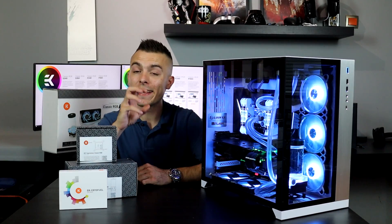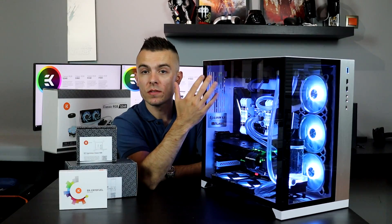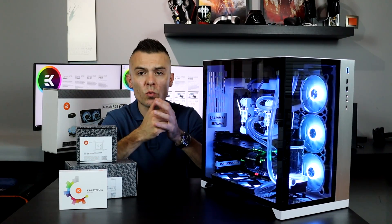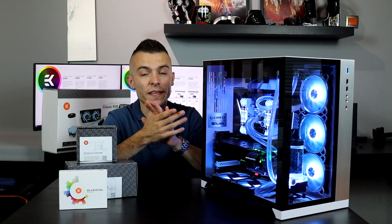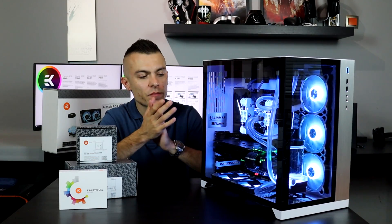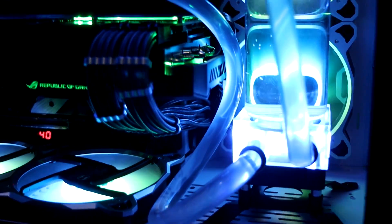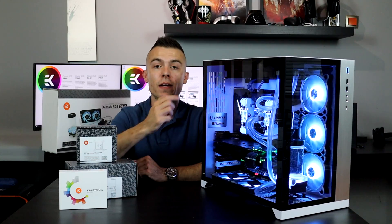As mentioned in the last video, the CPU block and pump have inlet and outlet labeled, so you can't make a mistake building the loop. I prefer this order: the radiator cools the water, water goes directly to the reservoir which accumulates cold water and gives the CPU enough to cool it down. You can do it another way — the difference might be a few degrees, not really noticeable. Alternatively: from the radiator it goes directly to the pump, from the pump out to the CPU block inlet, and from the CPU block outlet back to the radiator.